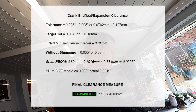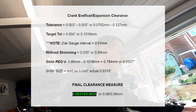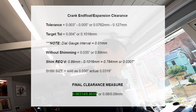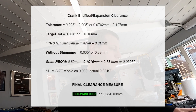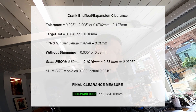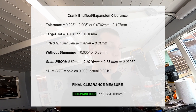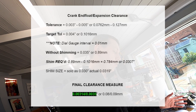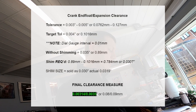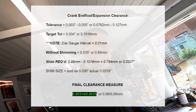Fortunately in the PES kit you get four shims of different sizes — there's a 5 thou, 10, 15, and a 30 thou. We took the 30 thou shim, dropped it in, bolted the cases down, and then remeasured. You should never just assume — oh, it was 30 thou clearance, I've put the shim in, it must be good. You check that you've got free rotation on the crank and that you've actually got the end float you were expecting. That final measurement came out at 0.08mm, which is 3.14 thou — right at the bottom of the tolerance, but we are good.